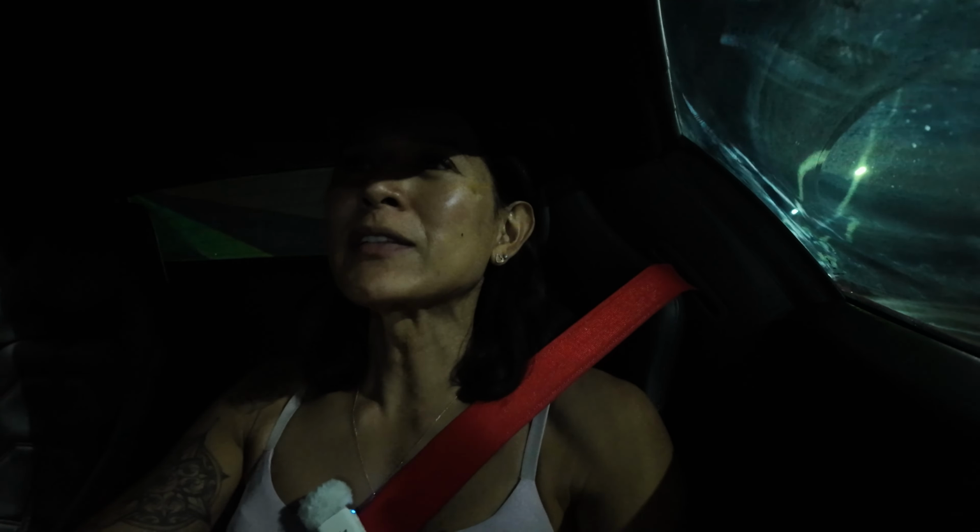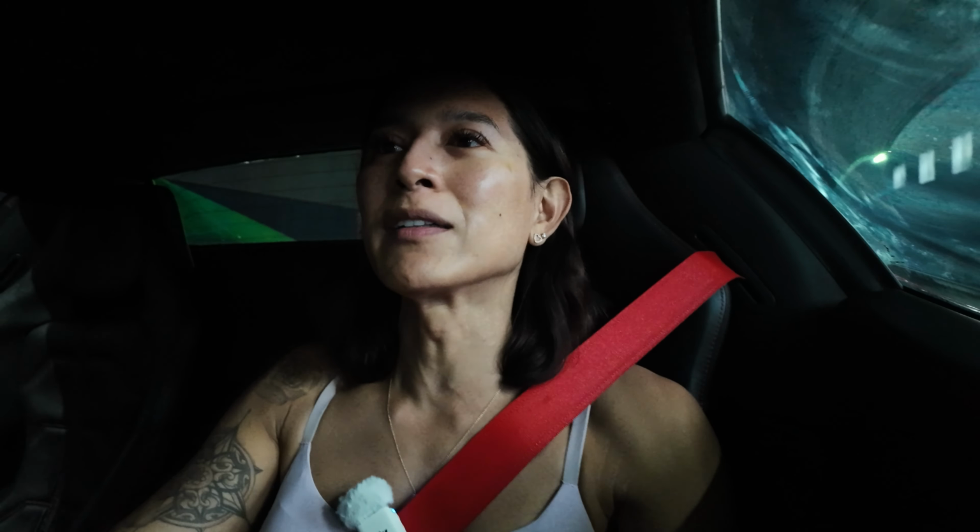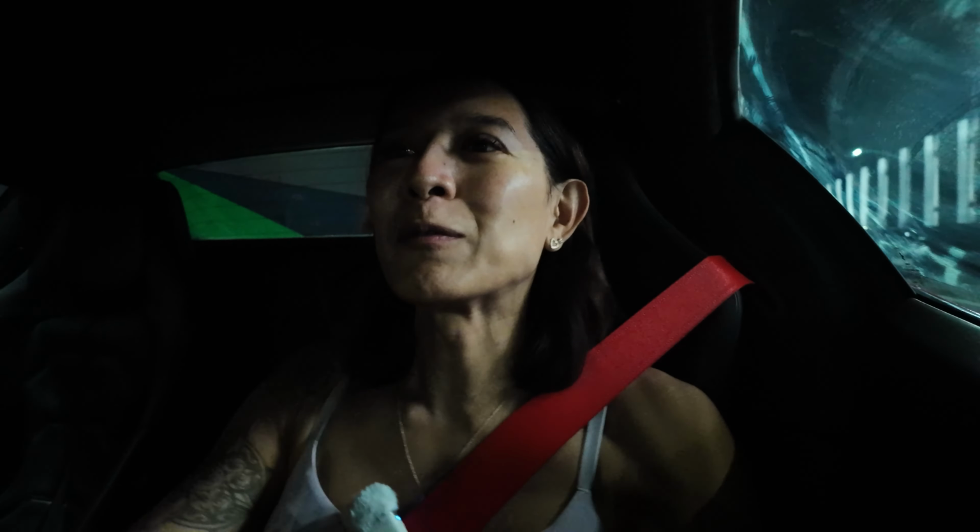So the issue with the scan that we first uploaded was when we scanned Victoria, it was on a lifter, which means the suspension arms are on full droop or full down, which means also the ride height of the car is wrong. So ride height is such an important factor because during maximum downforce, your ride height changes, and we have to sort of design the aero based off the ride height target that we have.